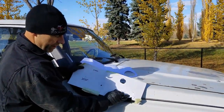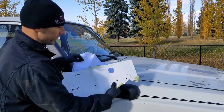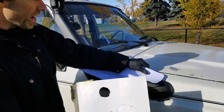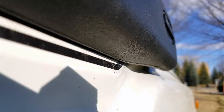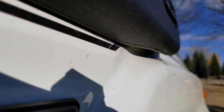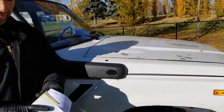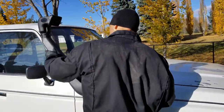This template gives you the center point hole for the hole saw. Line the template up and make sure the snorkel hole is just above where the fender starts to curve - you don't want your hole saw to hit the curved part of the sheet metal. Hopefully that helps with the template. On this particular install, we did the two riv nuts and two rubber washers underneath them, with stainless steel hardware.